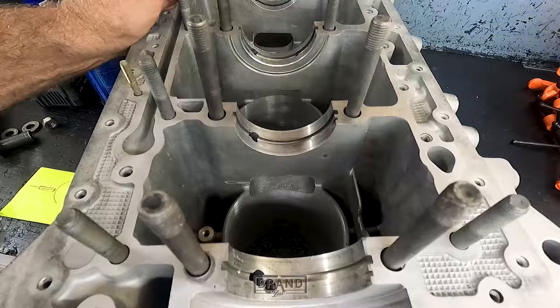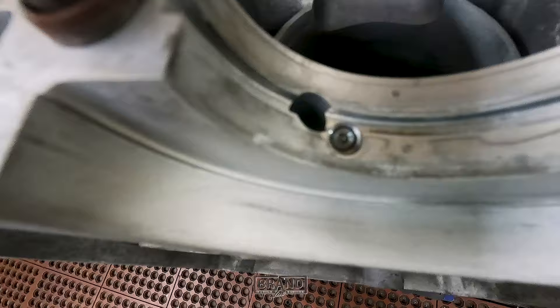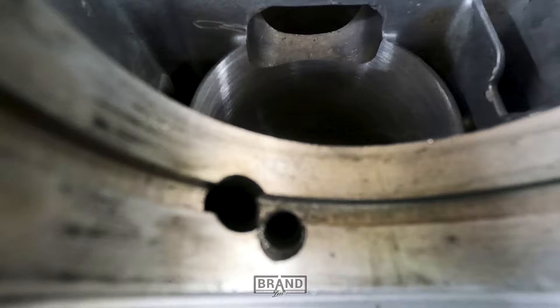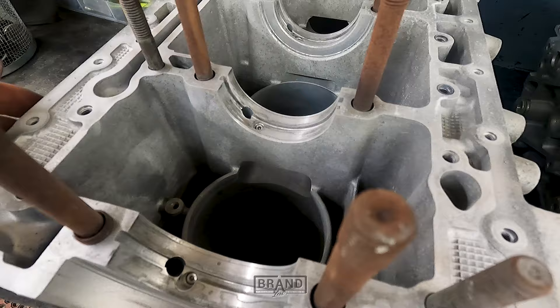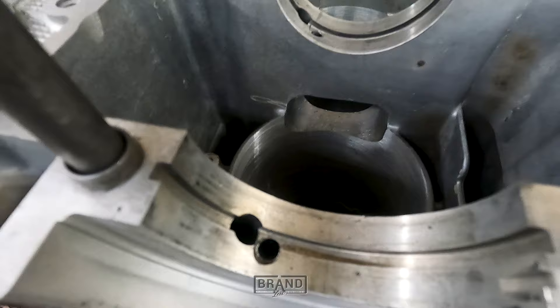I'll do the other three mains here. That's a little more detail on putting piston squirters in a Porsche block. Here's a factory block — these oil squirters were put in right here by Porsche. You can see what it looks like when it's pressed down in there; not a lot of press. That's what the factory one looks like. And this is the block that I've done without the squirters in it yet. We use the exact same little squirter that's in the factory block in the ones that I modify.